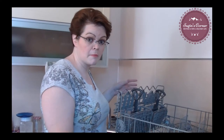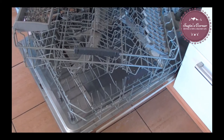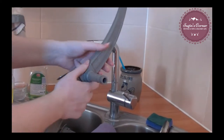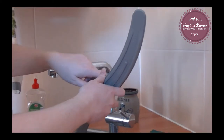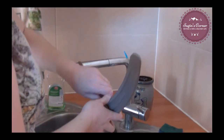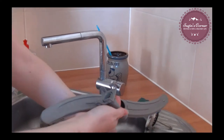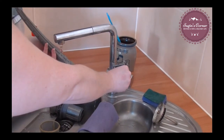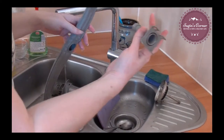I'm going to put some of these back down here for now. I want to thank Samantha for lending me her dishwasher and letting me teach her how to clean and put salt in it. Now, we talked earlier about these little holes. You're going to see this little clip on here — it's very easy. All you do is take a spoon; you don't want to use a knife. Let me just pop this off. Sometimes there will be food stuck in here. You can just take it — I'm going to lower the water — and you can see water coming out the holes and we don't hear anything rattling. This is cleaned out. Very simple. We just put it back on.